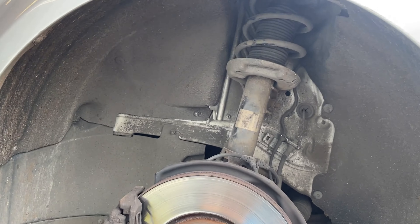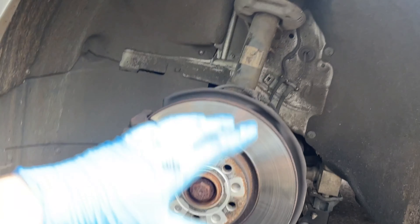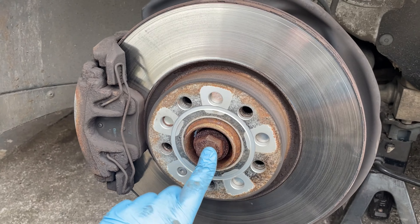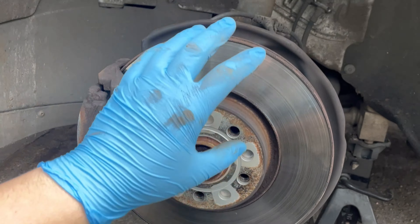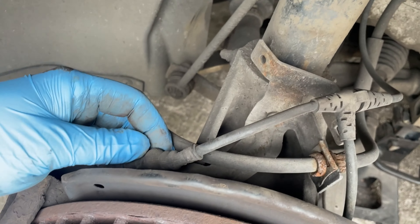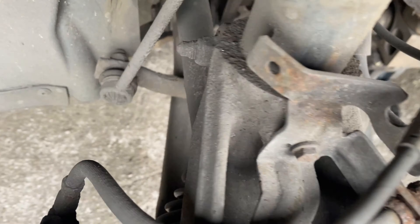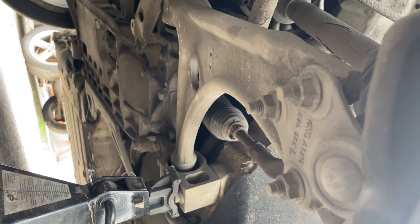Now the wheel's up, this is what we're greeted with. To get the strut out there's a lot to take off: swing the caliper back, remove the disc, get the drive shaft out for the wheel bearing, take out the ABS sensor, brake wear sensor, brake line tab, tie rod, and get those three nuts out for the wheel bearing. Then we can pull the hub out, replace the wheel bearing, get the strut out, change the spring. I'll time lapse this but voice over what I'm doing.